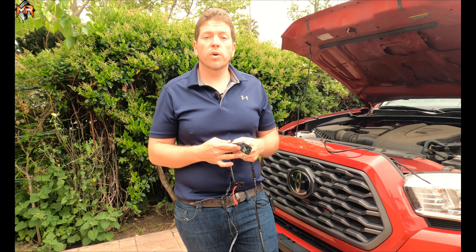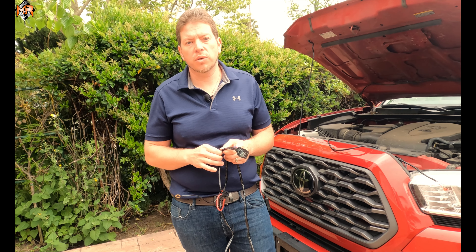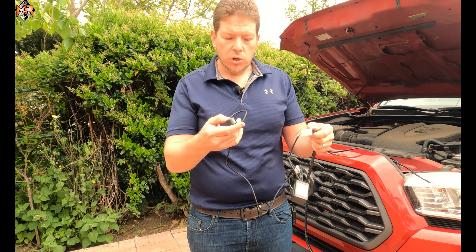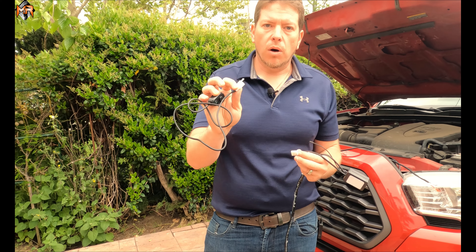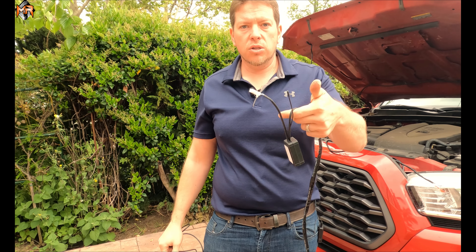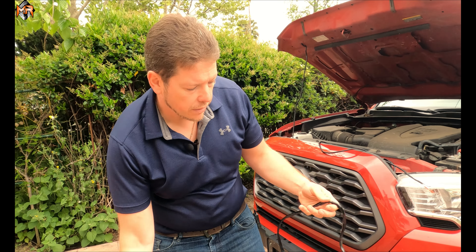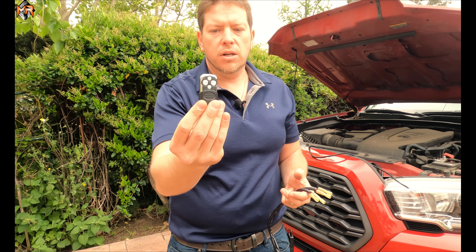For this install we use a generic wiring harness with a wireless remote. M&R does not provide or sell the wiring harness, although we will put a link in the description where you can purchase one on Amazon. The harness has a relay and gets connected to a positive and negative terminal on the battery. On one end you have a remote control plus a wireless module — if you don't want to drag the button inside the cab through the firewall, you can just use the wireless feature. On the other end of the wiring harness you have two leads for two separate light bars, but we're only going to be using one, so we'll cap one of the leads. The remote lets you use it as an on/off as well as two flasher functions.